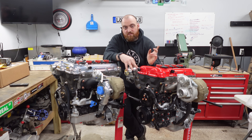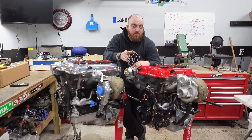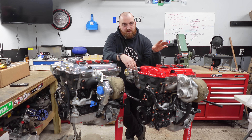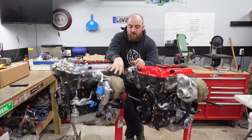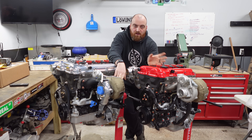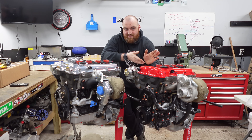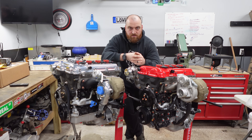I'm actually going to be building an engine for a buddy Corey and we're going to run a G25-550 on his. My buddy Jonathan from JPT Performance is also running a G25-550. The nice thing is you can get pre-built downpipes from Kraken that fit all those options, whereas with Flying Miata it has to be the Garrett-style housing. For turbo options, another vote in my opinion for Kraken — this is more than aesthetics, it's a functionality upgrade. For turbo selection, Kraken takes the win.